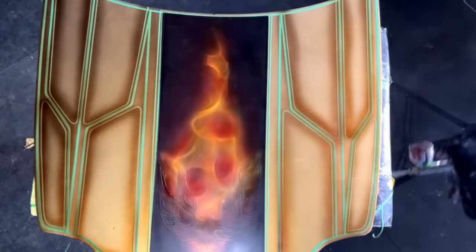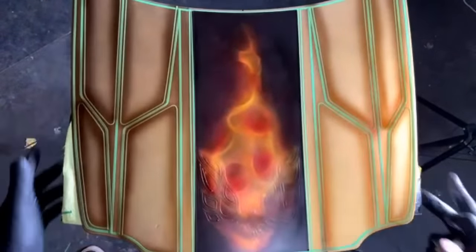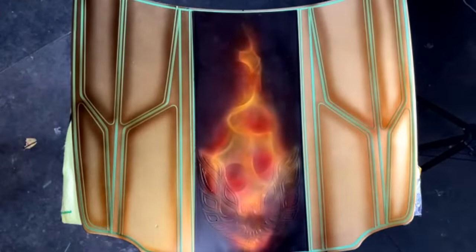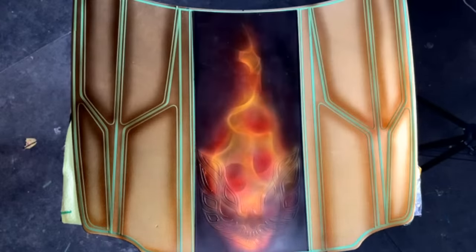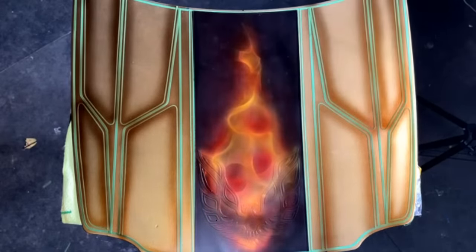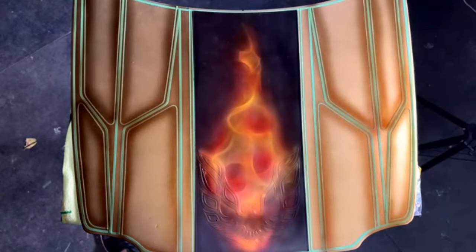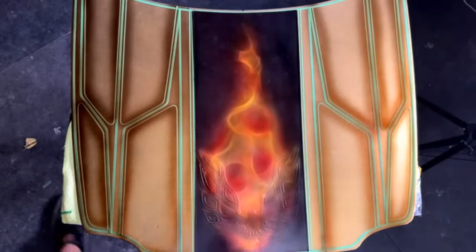Ryan said, I have a plastic bumper I sanded with 80 grit and 220. I have some dents and gouges in it. I'm going to epoxy it. Is it better to Bondo before or after epoxy? You can do either way. Either will work. But if you want it to be bulletproof, you would epoxy first, then scuff it down. Then you do your body filler over that, because then you're sealing that metal off before anything else is there trapping any kind of moisture. But you know, I don't think everybody goes the extra mile like that. So it's really up to you.